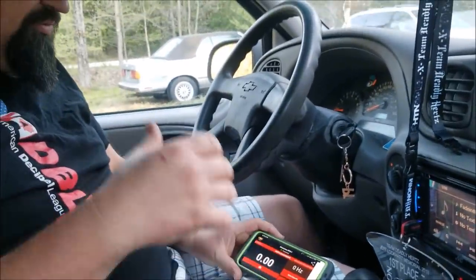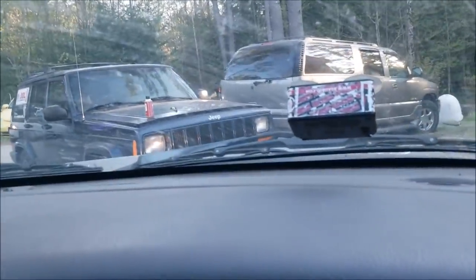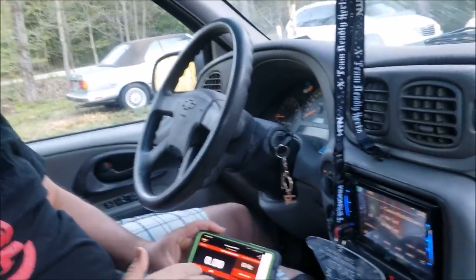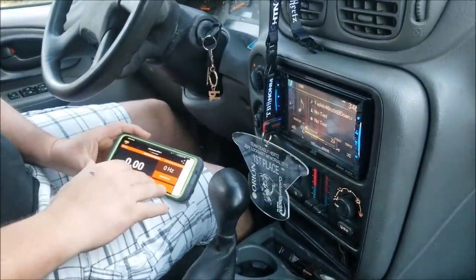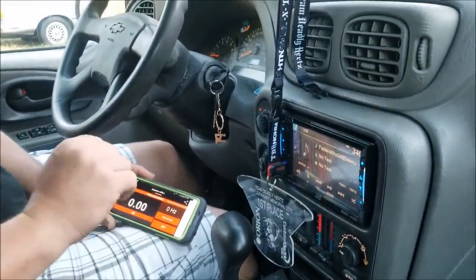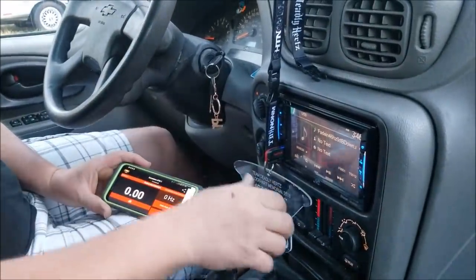We're in the car, we've got everything set up. We've got the SSA APM One meter — you can buy it at SSA.com, they're around $450, and it's Bluetooth wireless to your phone. It's going to give us a decibel reading. We did some preliminary testing; we know at volume 23 we should hit around 130 decibels flat, just for testing purposes, with the sealed plugs in.